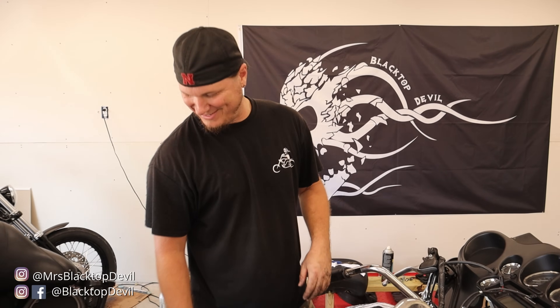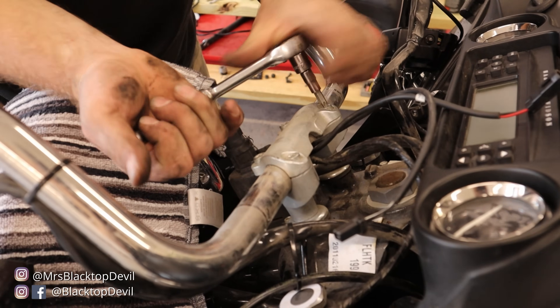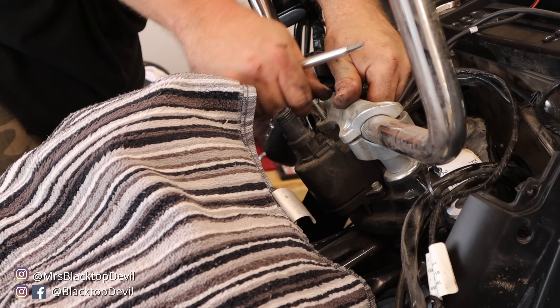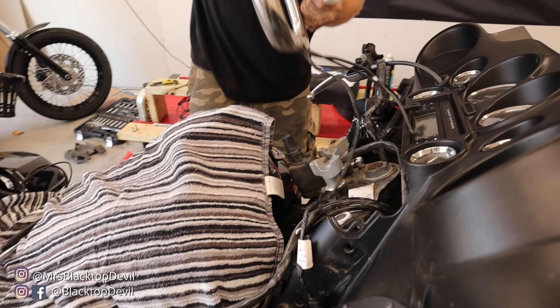The easy part's done. We're going to loosen all four of these bolts — this is a T40 Torx on this one, some are a quarter-inch socket head. If you've got a big belly like me you can shove the bar in the end of it and then it just holds the bars from falling back on your paint. The top cap will come off and the bars should lift right out. We'll have to take the bars to a bench — it's a pretty involved process pulling pins and everything.